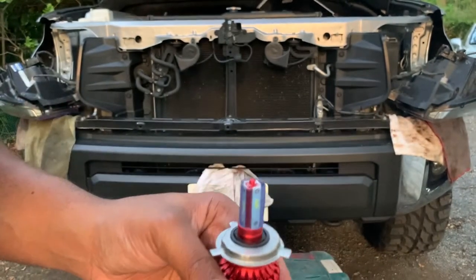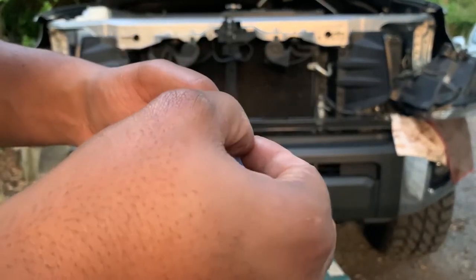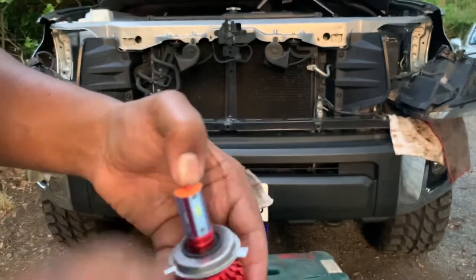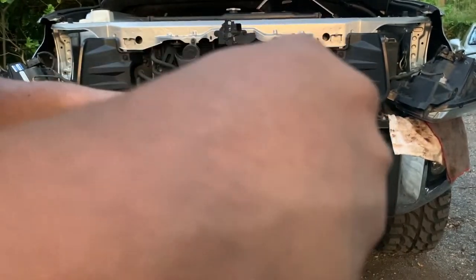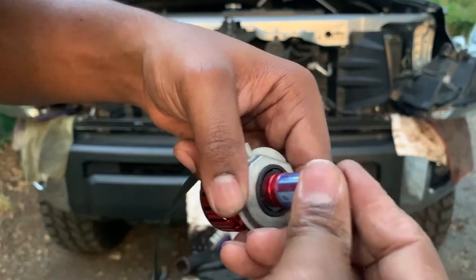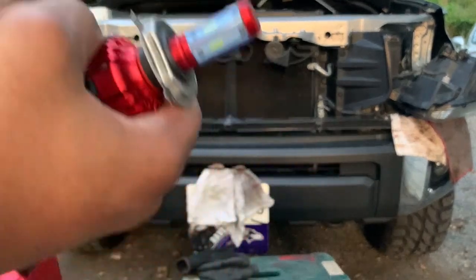Okay, that's excellent. So it is glass, just for people that wanna know, because I was wondering, is this plastic that I'm putting on? Because it wouldn't make any sense, because plastic around any type of bulb would burn. You wanna get it tight enough, not enough to crack the glass, but enough so you can prevent any fluids or anything going inside, prevent condensation.